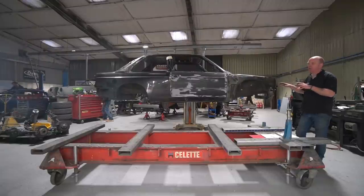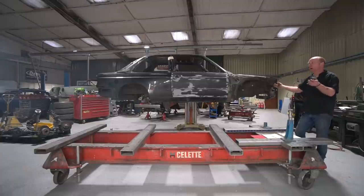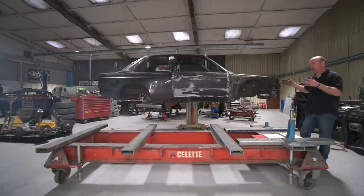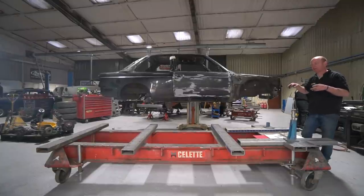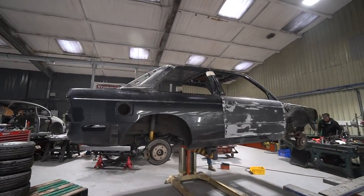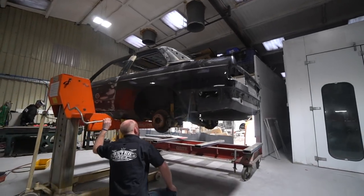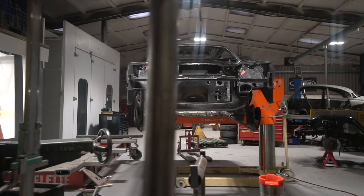There are other types of jig more common in crash repair, which are the generic pull-type jigs — a small frame that goes up underneath the car, bolts onto usually the sills or four key locations, and enables you to pull crashed parts of the car back to shape. A laser-based measuring system is typical on modern versions, where you use a laser to check alignment of all parts and pull until they're in alignment. That type is not so useful for what we do here. The frame-type machine is more useful when you're trying to hold a given body shell in alignment while you do some radical work to it.